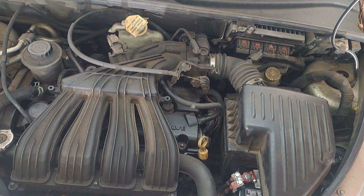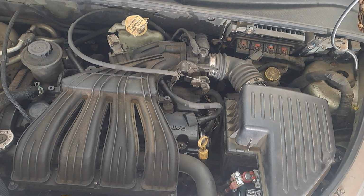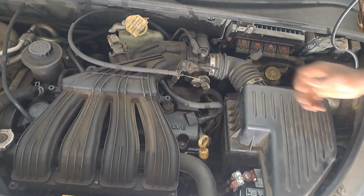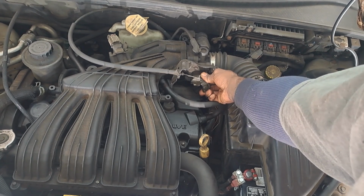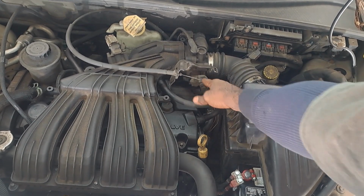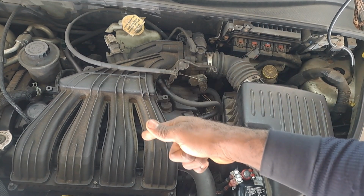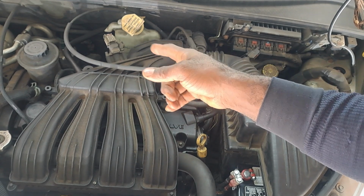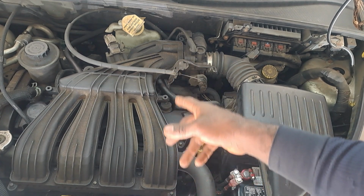This is very dangerous. I've had cars catch on fire. So yeah, be very selective. So let's listen to see if it actually starts up. If it hits, then we're just gonna check for fuel delivery. Darn it. So it works. That means that our crank sensor is working to control the injector pulse and the ignition system. So if it controls the fire, then it's likely going to be able to control the injector pulse.